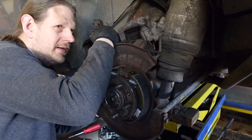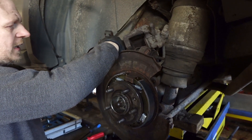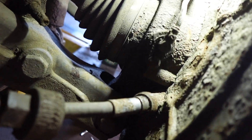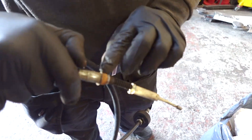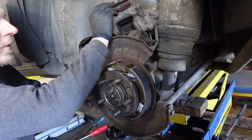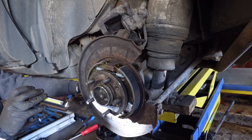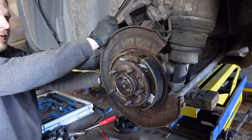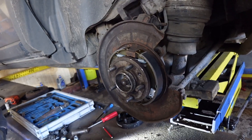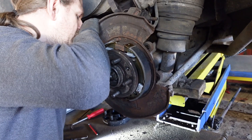If I feel like it's had a different module put on here or someone's been here before me, they have C-clips, like little circlips, on the cable which affect the length of the cable. So if you look in there, there's still slack on the cable. But the way I've set that up, there should be no slack — I've just got a little clip on the cable. So this has had a new module fitted at some point. But they've not put those clips on, so we're losing — up to maybe one and a half centimetres — just off those clips not being on and that slack in the cable. So if you're fitting new cables, you want to check whether it's got a clip or a circlip on it. And if it hasn't, you've got to order that separately.